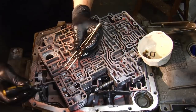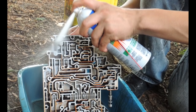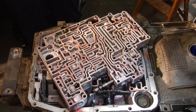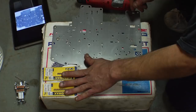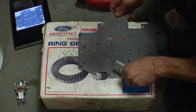Now your valve body is ready for cleaning. Take it over your pan, get some brake clean, spray it with your safety glasses on because it's going to go everywhere, until this is completely spotless. Once it is, it'll be time to reinstall all of those pieces back in. Now it comes time to drill the plate. I have read a lot online about guys really freaking out about this part — they want to use a drill press, and this and that. Relax. This is really easy. We're going to get our two drill bits and leave them in their packages so we know which size is which, and not remove them until we're going to use them. Having downloaded the plate number JPEG from TCCOA and various JMod write-ups on crownvic.net, we are going to first identify hole number two.